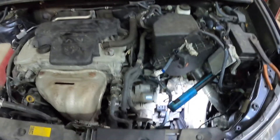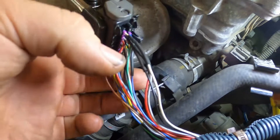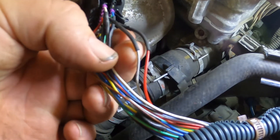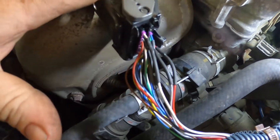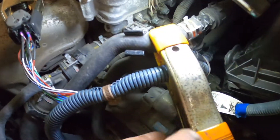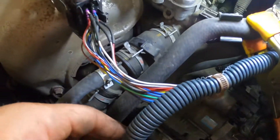This must just be a freak thing happening on this car. There was enough wire that I was able to solder all the wires back together, and I used some heat shrink tube to put it all back together. I used a clamp to steady the connector and another clamp to keep it from falling down. Now I'm going to wrap this with black tape and then put the covering back on and get back into the transmission.